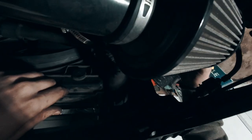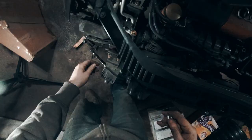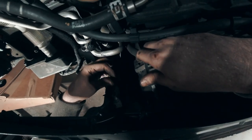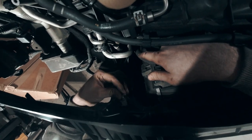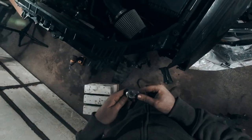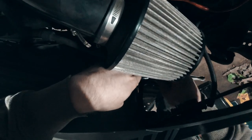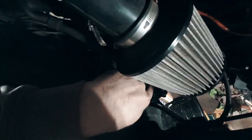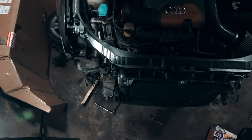There's the whole headlight thing, I still have to do that. Now it's worth noting that these sensors only go in one direction because they're keyed — so you literally can't put them in wrong. If they don't just fall into place, you need to turn it around. I'm sure there's a torque spec for all of these, but considering they all thread into a little metal insert in fiberglass reinforced plastic, I'm not going to go that tight. Everything is back in place.